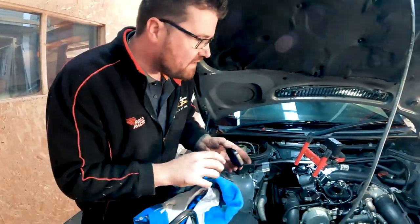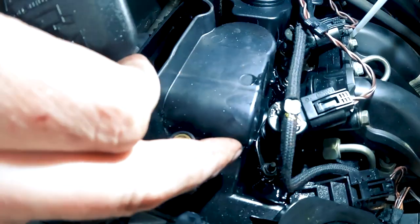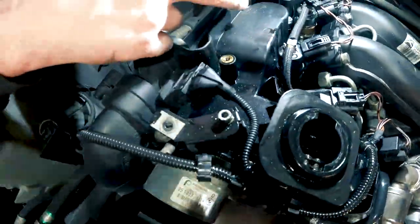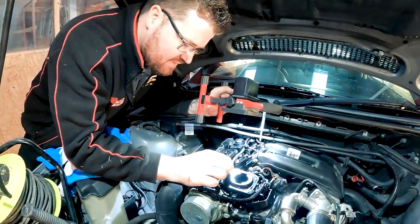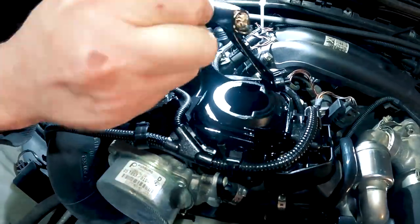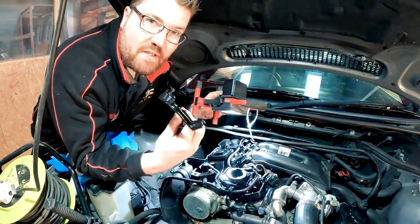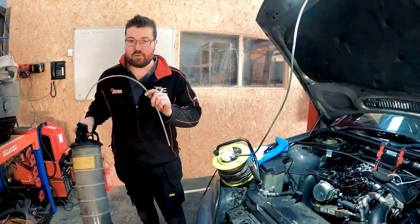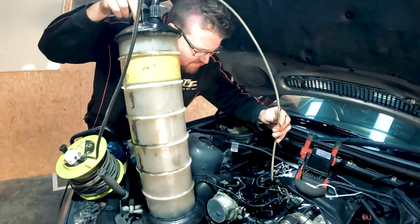This one is going to be baffling. We have a very recent puddle of oil here down around all the injectors, but I can't seem to see where it's coming from. I've never seen this happen before. There's a lot of oil here, so I'm going to run the engine, clean this up, maybe get a new oil seal, maybe a new oil cap, and see how that goes. I'm going to try and use the oil sucker to take the oil out. I know there's not a whole lot in there, but I think this might be the easiest way.